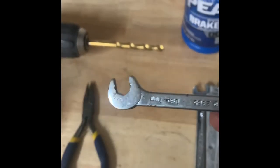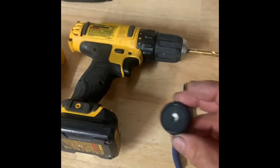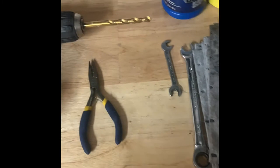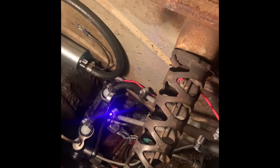What I did was drill a hole in the cap, kept the gasket in there, and blow air into it to pressurize it. You'll need a number seven millimeter wrench and a quarter-inch bit on a drill motor to drill your hole. I made my cap so it fits on here — you can see the hole on there — and it purges down through here.